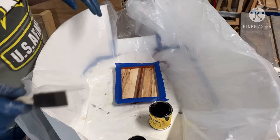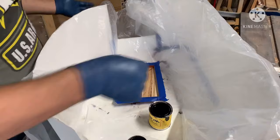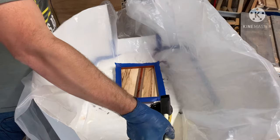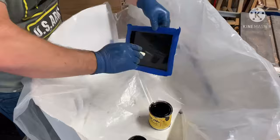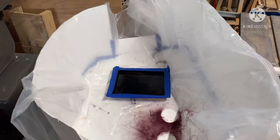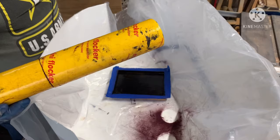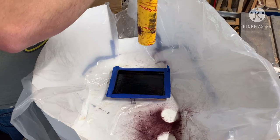You want to do this in a well-ventilated area. I had a section off to the side where I would put the fan, but for video purposes I won't have the fan on right now so you can see what's happening. I'm just going to get a little bit on my brush and coat it up, making sure there are no dull spots. Then I'll point the mini flocker straight down and put a nice even coat of flocking on it.